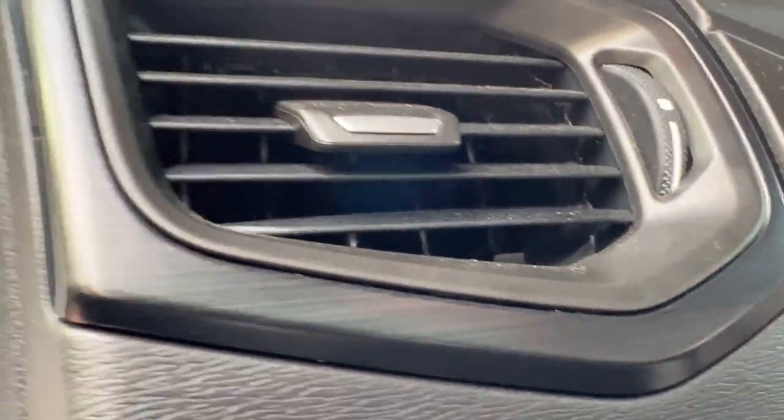In this video I'm going to show you how to get to the fuses inside the cab of the Scania R-Series. Now in the UK model it's on the near side, so you open your passenger door, come to the edge of the dashboard. There's your air vent - come round to the side and you've got a plastic cover.